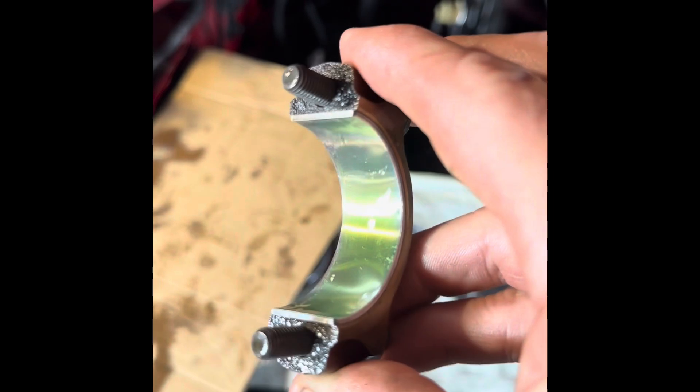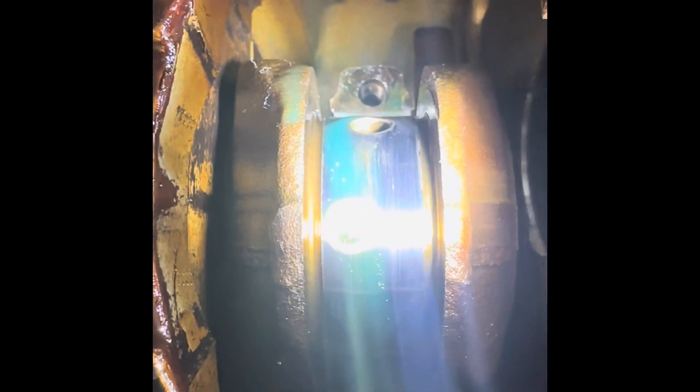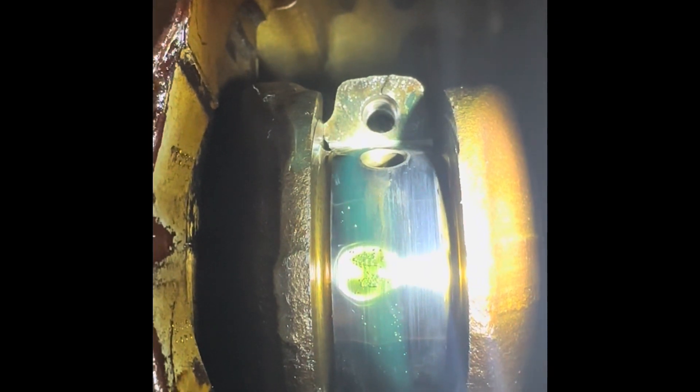So now I'm going down underneath. I'm going to put a load more lube on that. Up under here — there's one end and there's the other, so make sure it comes down right and it's square. Al, can you just push the piston down for me? See there, it's locating — keep going. That's set. So that's set nicely on the top of the crankshaft journal.